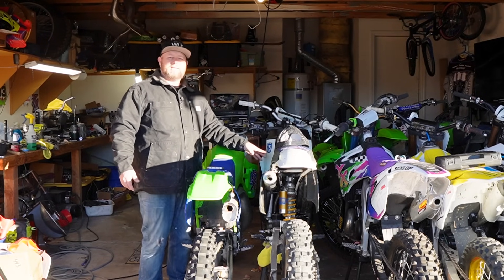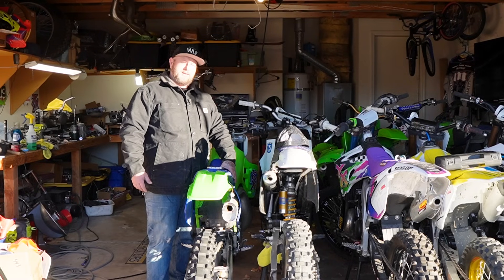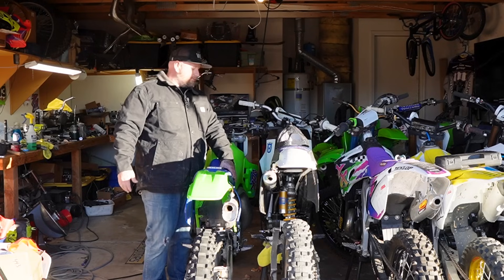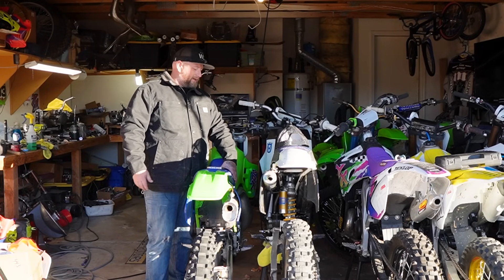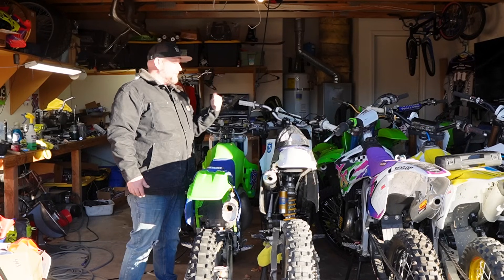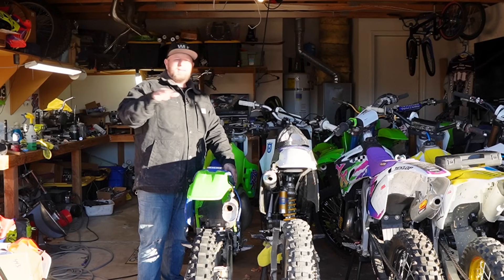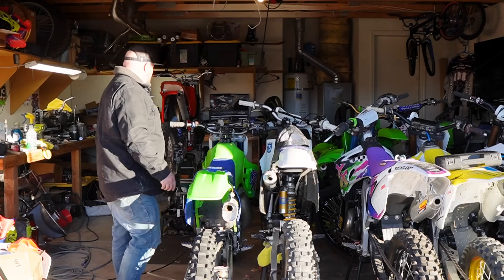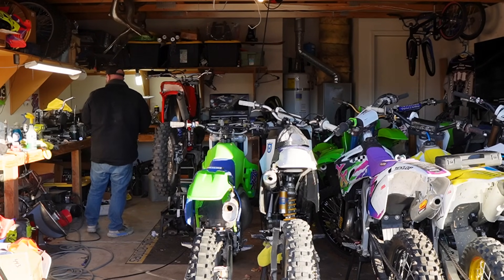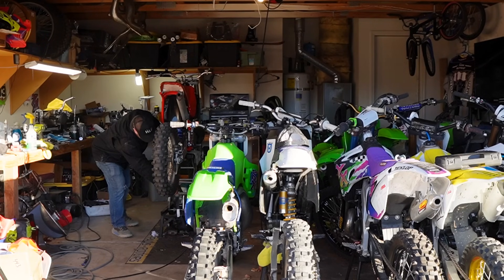It backfired on me when I was kicking it — that's a future video. With the kickstarter gear fix, I also fixed the timing. Some previous knucklehead that owned it had advanced that timing all the way — it was sparking mid-stroke on the piston, way too advanced, so we put it back to stock. The 89 CR500 behind me is on two wheels. As I said in the last video, you're not going to see any more from that bike until the reveal. This is not a turd bucket — it's a racing bike.